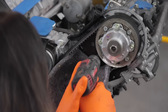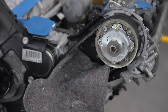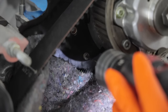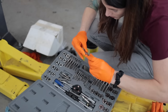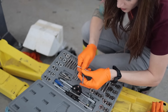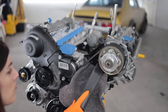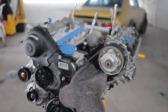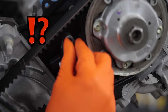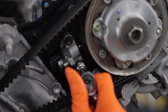The key to successfully drilling out broken off bolts in an engine is: one, have quality drill bits; two, know what you're doing; and three, have hand-eye coordination. If you don't have all three of those, don't even try. M6 by 1.0 maybe? Yep. The irony of the fact that I stressed about having quality drill bits, yet I'm using the cheapest tap and die set possible. The cam position sensor — the moment of truth. Will this hold 66 inch pounds of torque? Yep.